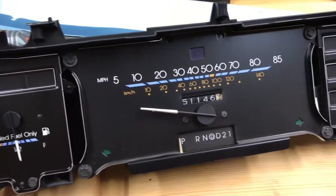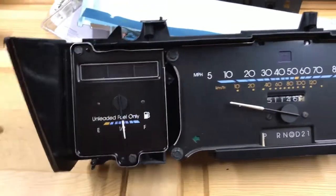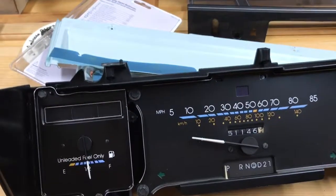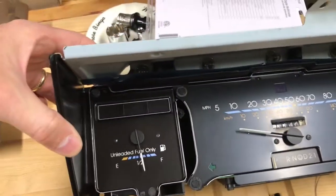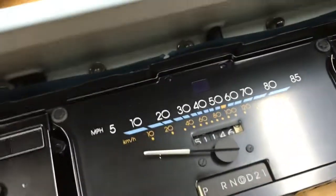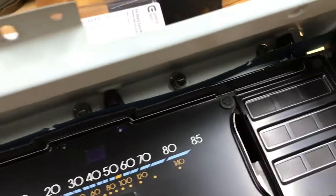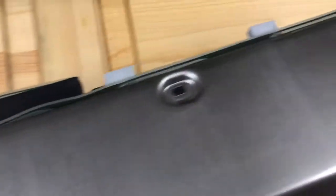I'm going to check a few more things on the speedometer lubrication and then we'll reassemble, putting the sheath back on top. Here you can see I've just gently folded the sheath back on top. I've aligned the plastic piece underneath — it is reversible, that blue piece. On top, I made sure that the holes are aligned as well.